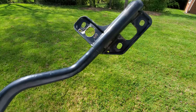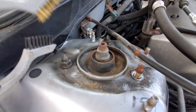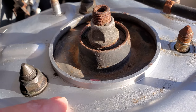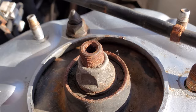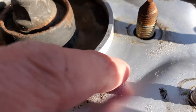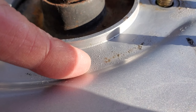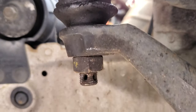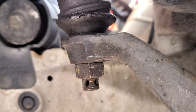I'm in the backyard about to spray this down and clean up the area. I cleaned up both sides — it's a lot cleaner now. I'll clean more once I get rid of the two hex nuts still holding the struts in place. But you see these little tiny bubble spots? That's usually a sign of rust. I hope it's just on the surface and not penetrating from underneath. Now that the cotter pin is out of the way, I'm going to go work on the outer tie rod and take that castle nut off.